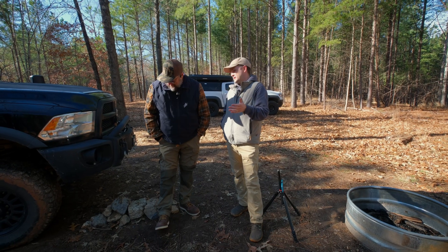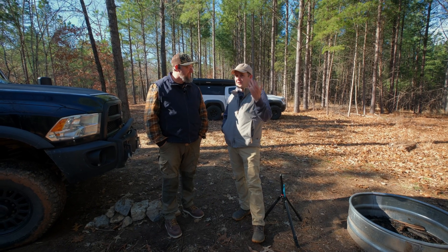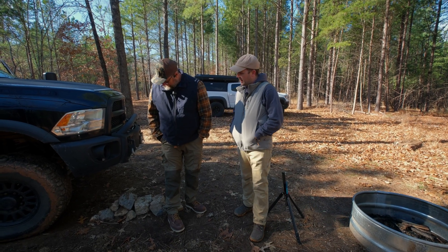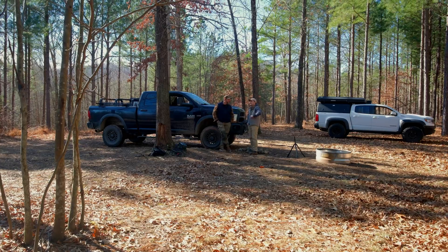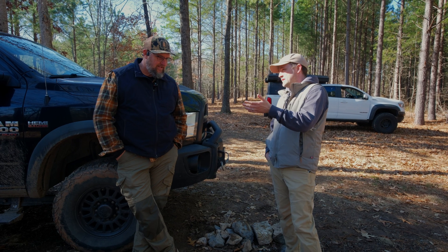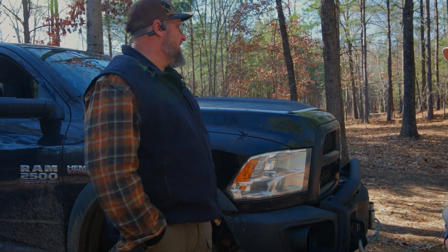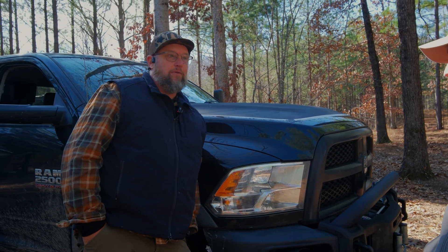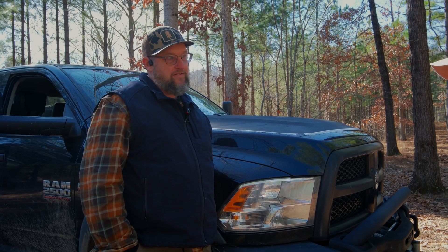One thing I noticed at the lowest PSI was not so much the obvious flex of the tire, but just how much smoother it made the rock pile feel. I actually didn't even know when I was up on it. So at a third of your everyday PSI — yeah, this showed it a lot more. But then you said this is not necessarily your strategy, right? In a lightweight vehicle with a six-ply or E-rated tire, you just don't get the footprint that you think you do. They're just not heavy enough. Typically people have super heavy tires on a truck that just doesn't weigh that much.